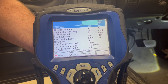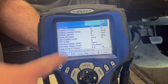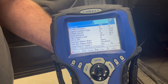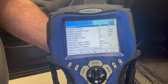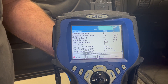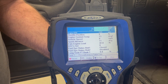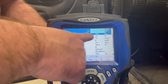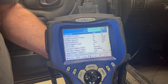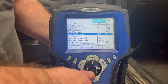Next I'm going to finish my lab and give it 2000 RPMs — when I increase the RPMs to 2000 my values will change. Let's look at throttle position: it's at zero, but when I push on the gas you'll see it goes up as a percentage. We go up to about 2300 RPMs, then to about 3000 RPMs, and you can see the throttle position changes — so we know that sensor is working. When we go back to idle it drops to zero after we let off the gas.